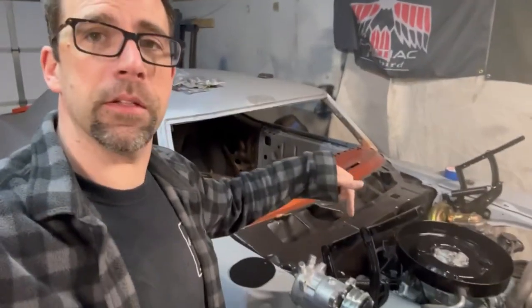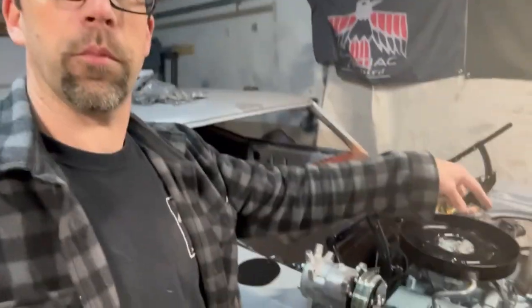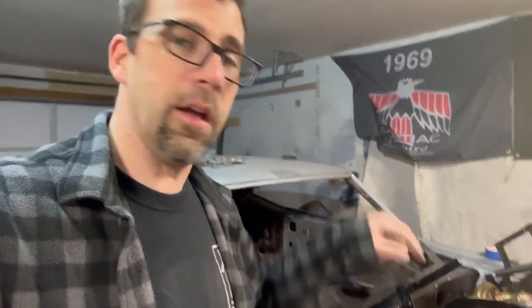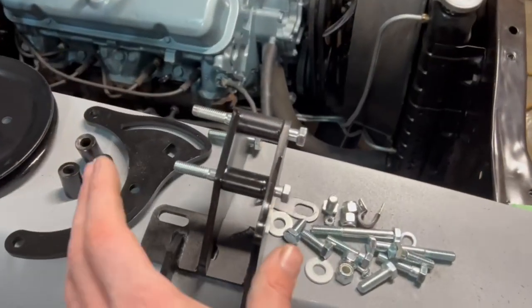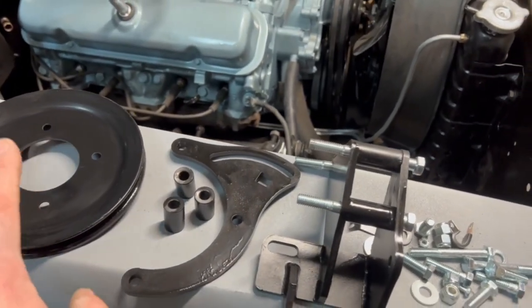One of the steps of making that happen is getting the AC compressor mounted. With this kit, the AC lines came with only one end crimped, extra long, so we can route them from where the compressor is going to reside, up through the firewall and cowling into the heater box. Once we get our length and clocking figured out, I borrowed a crimper to crimp the hoses. But the first step is definitely getting this compressor installed. Here's the compressor bracket that came with the kit — a couple pieces — and here's the pulley.